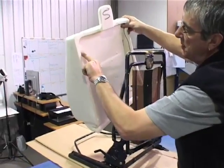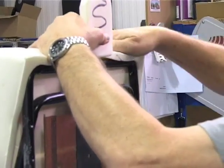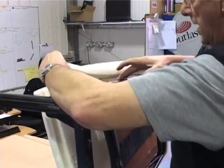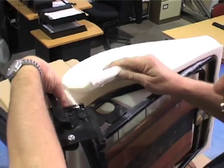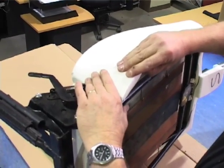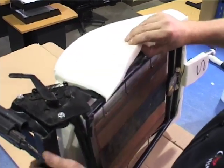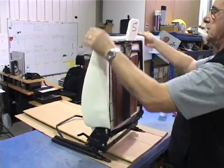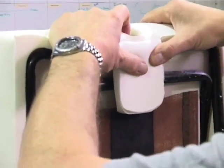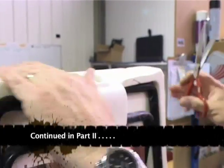This bar now sits in the shape of the foam. Start with one corner, get it into position and just touch down gently. Go to the other corner and set up. Turn the seat and the foam onto its side, making sure that the bar sits right in the foam. This straight bit here goes to the underside of the bracket. Before you touch your foam down, just pull it to the top of the seat slightly to lift the foam up and touch down. Set your foam up so it's more or less level with the tubing. Run your hands down the sides to make sure it's all bonded. Using both thumbs, just roll that back over onto the bracket and snip them off — otherwise that shows through the cover.